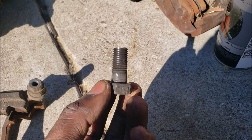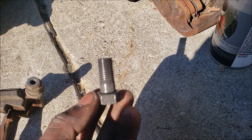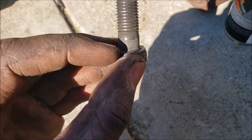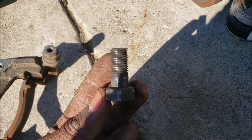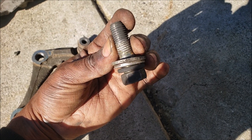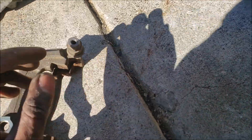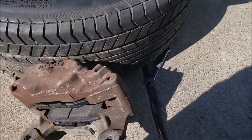The holes between the E30 and the RX7 — both are the same thread pitch, so you can use either one to find the right size. Make sure the thread from the bottom of the head to the top is about 27 millimeters long. If not, you'll have to use a bunch of washers to get the spacing correct so it doesn't touch the rotor.